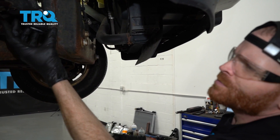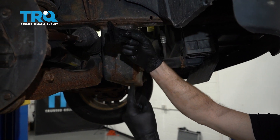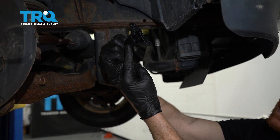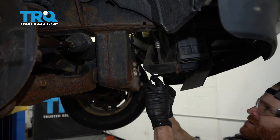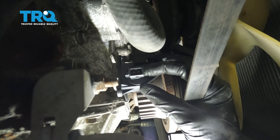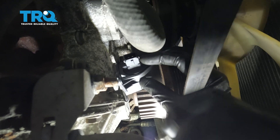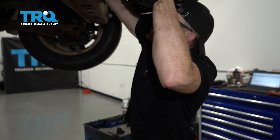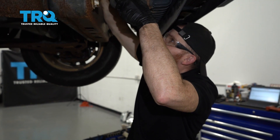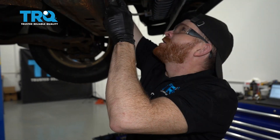Now it's time to install our brand new crank position sensor. When we do this, we want to have it aiming generally in this position so that the sensing agent is going to be facing towards the crank. I've got both my bolts in my hand — I'll get it in position and start in both of these bolts. Once they're started, we'll snug them up and then torque them to 89 inch-pounds. Now that I have them both bottomed out, let's go ahead and torque each of these to 89 inch-pounds, and now we'll do the same to the other one.